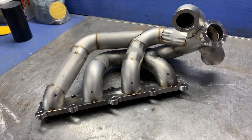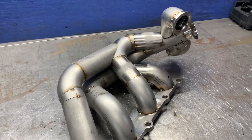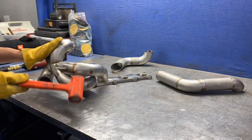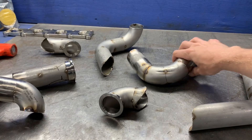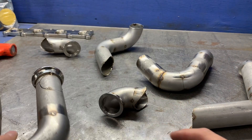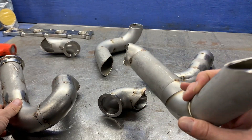I skipped the building process — one, that's in the back of the motor crammed up against the firewall so it's really hard to see; two, it's just a lot of cutting, grinding, trimming, fitting, repeat over and over again until you kind of get to this. Now that everything's broken apart, you can see this is where one tube merges. I'm going to cut that out, this one I've got another tube merging, wastegate, anti-lag, and so on. Once I get all those cut out and fitting somewhat well, I will go through and clean and polish everything inside and out and get it ready for welding.